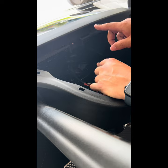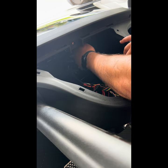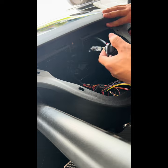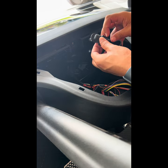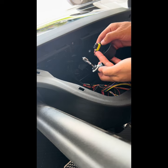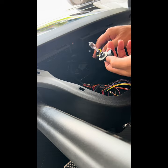We did a little angle change to make it easier to see. The lights are right here on the right and left. I'm going to reach in, pop it out, and show you how to disconnect it. You twist away from you and it pops out — super simple. Lots of room on these lights. Take these off: you've got a clip on the right and a clip on the left. It might be a bit snug — keep in mind these vehicles are meant for off-road use in water and dirt, so that gasket is there to protect the lights.